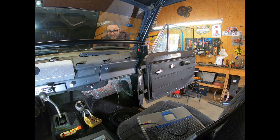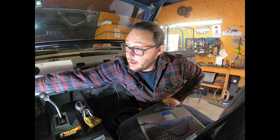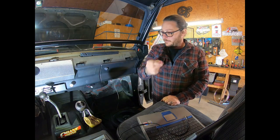I can feel the IAC vibrating. I'm going to unplug it, and I'm going to visually look and make sure that I can see the pencil tip all the way into its bore, which I can. I'm gonna come back here. I'm gonna turn the key off, and then I'm gonna remove my jumper.